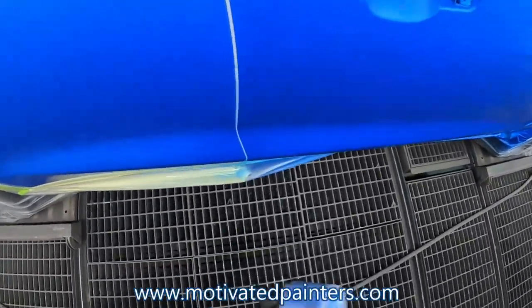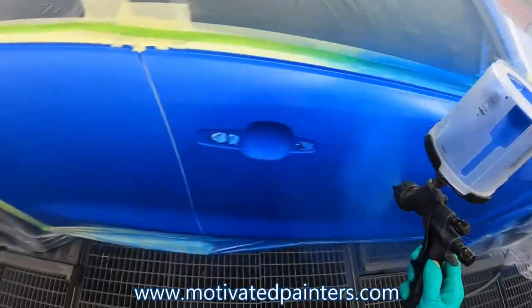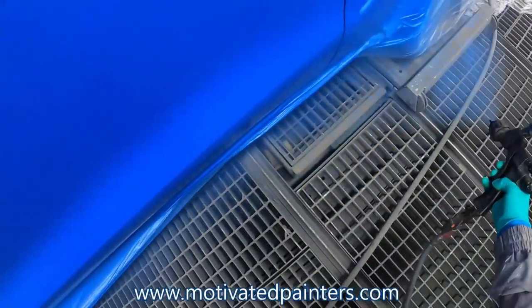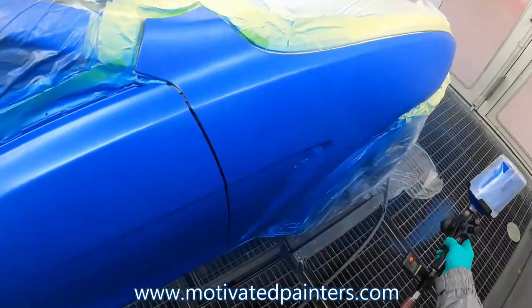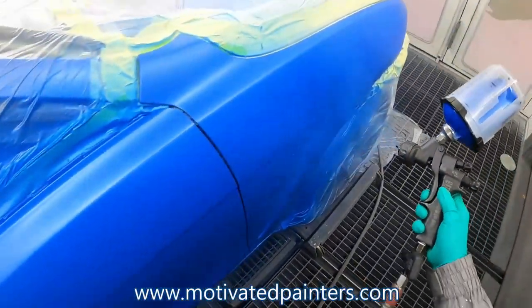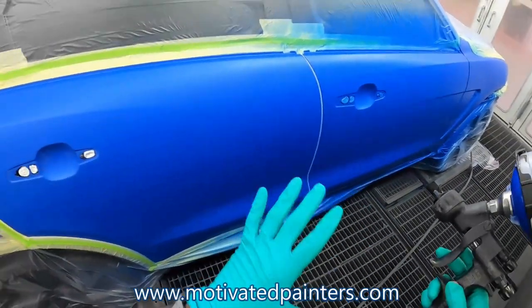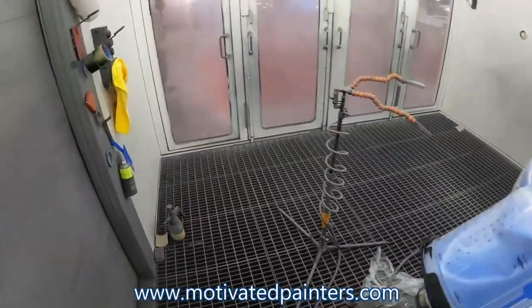This is a control coat, the last coat before clear coat. And as you can tell, I'm putting it on fast, putting it on dry, right? And still letting the gun do the work. I do a double control coat out of habit now, and it works very well in every single color I do. But you see how I angle the gun there? Look, it makes it really nice. Done. That's how you want the control coat. Light, no wet spots. You're good to go.